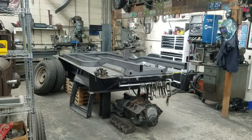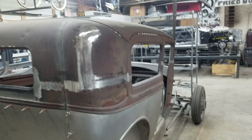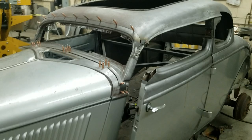I've got a 30-31 Model A sedan. On the passenger side I built a new corner a couple years ago. We've done a new corner, fixed some of the subrails, raised the 32 rails in the back, and tucked the gas tank up real high. That way it looks a little bit more proportional on the Model A. Next up is the steering, finish out the gas tank, and a 3-4-5 window — sort of chop it in real heavy.